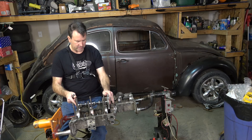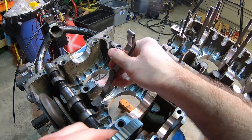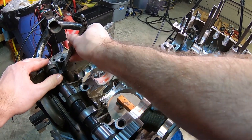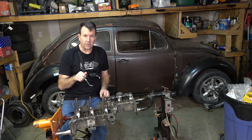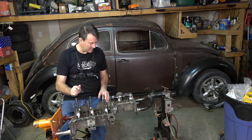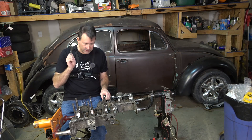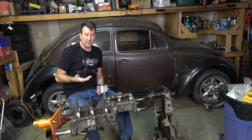That's good. Now let's stick it back in this case half. Beautiful - this is an important step. The last thing you want to do is grind your cam lobe off with a lifter. You've got to have clearance there, otherwise you're going to wind up shoving the lifter into the lifter bore. So you've got to make sure you have that clearance - clearance is always good.